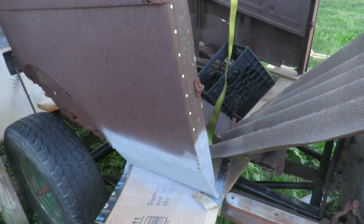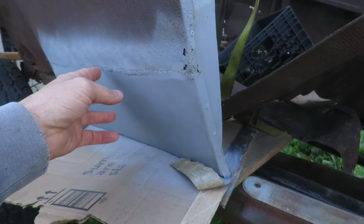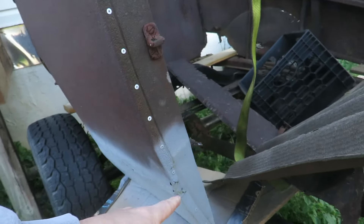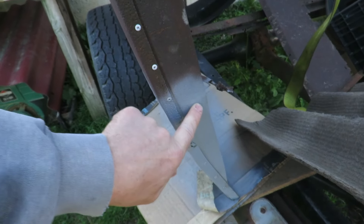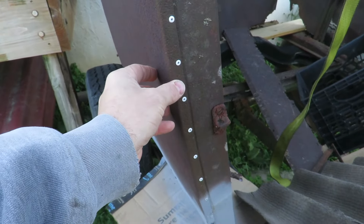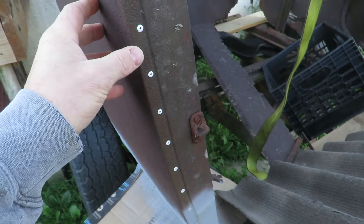One thing I'm going to do today is actually work on some of the body. Got a piece of sheet metal the other week and I'm trying to learn how to do body work. The welding isn't all that great on this one right here — I learned a lot on what I need to do and what I don't. I came over here and fabricated up this whole entire bottom section and as you can see the weld between the seam is a lot better, and then I ended up riveting the outside skin right to the B pillar.